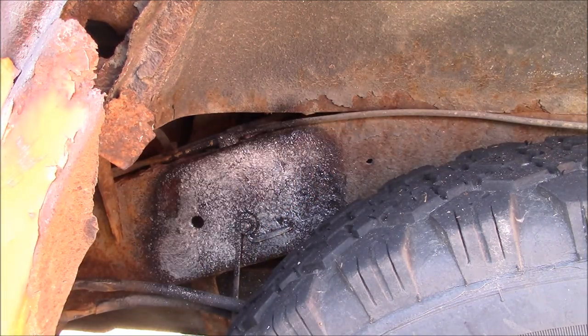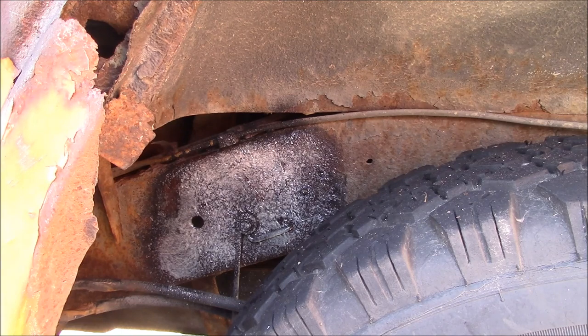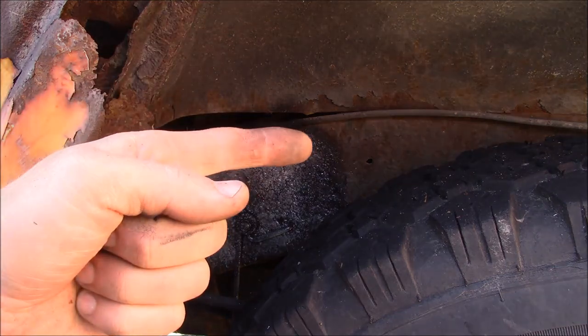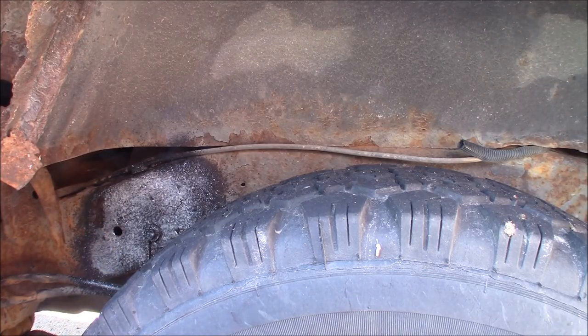So this new product, Wool Wax made by Kelsport Products — I'm hoping to use the black to coat this frame and give it a black look. This truck I'm not really worried about because it's the last run for it and it's really rusty. I never put Fluid Film on it before, and I wish I had about eight years ago. I'm going to hit this gun and give it a blast to clear the Fluid Film out of the tube, then switch over to Wool Wax black.